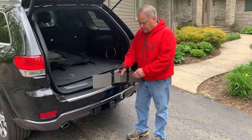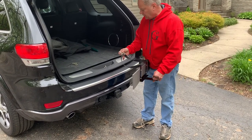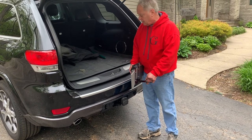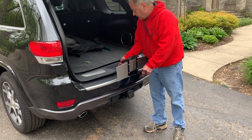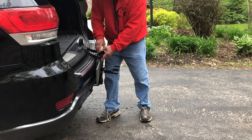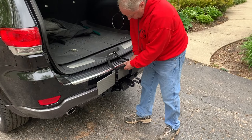Now that we've made the major assembly of our bumper hook, it's time to adjust it to fit our actual car's bumper. Take your center clip — in your car you're going to have a center mount. If you don't have a center mount, the product might not work. That's your trunk lid latch. Make the hook on. You're going to hold the hook just so that it's in the center, flush on the bumper. You're going to take these draw straps and get them nice and tight so that it hangs in the center.